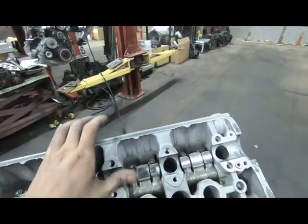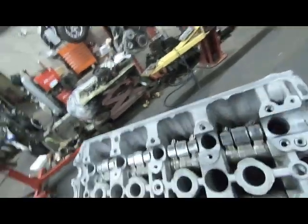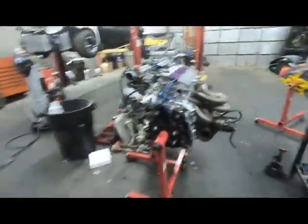There's a few little bits here and there still to do. Once Mario's clutch gets here we'll take his off, get the clutch on it, and get that back to him. For Jordan's - we're waiting on a tensioner. We already have the clutch and everything here in this box. I've got to get the clutch on this one, trans on this one, get it in the car. I'm gonna wait to get the tensioner first so I can do the timing right here and then put it in the car - probably this coming weekend or right after the races. Both of them are coming along really really nice - I sealed up both their oil coolers. Mario's looked like it was dripping a little bit, so I sealed them both up, cleaned everything up, got everything nice and tight.